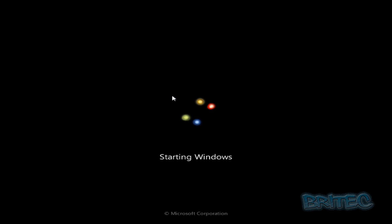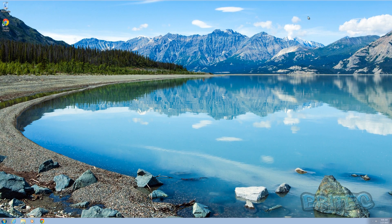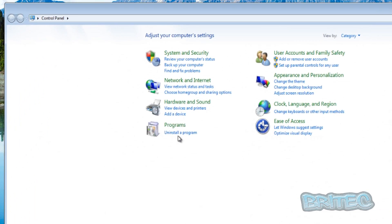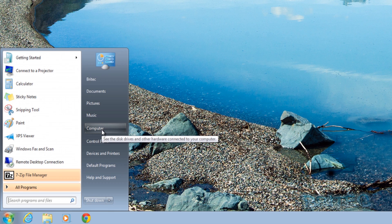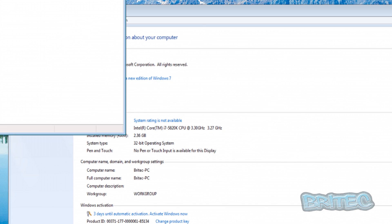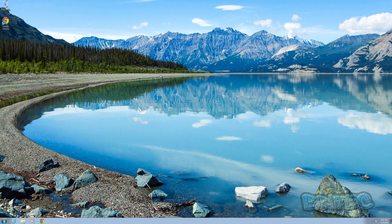Once you reboot your system back up to the desktop, you should get to the desktop because you'll have all the latest drivers on there — and it's as simple as that. If you still have any drivers you want to remove once you're at the desktop, you can go into 'Uninstall a program' and remove any old drivers you don't want. You can also go into Device Manager and remove any old ones from there as well. In Device Manager you would remove anything you don't need anymore from the old system. This is just one method — there are plenty of other ways of doing this.